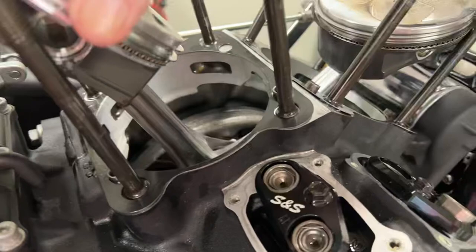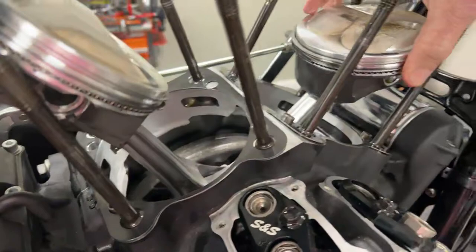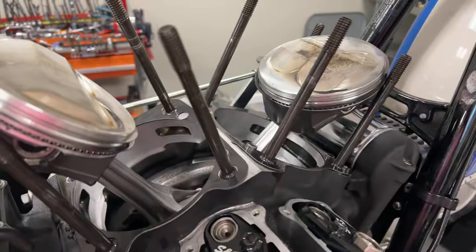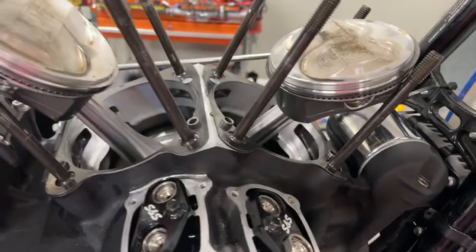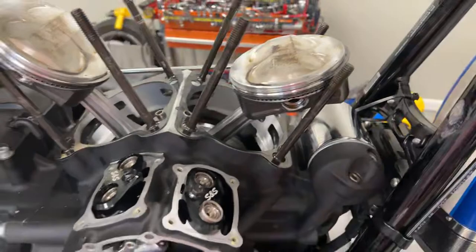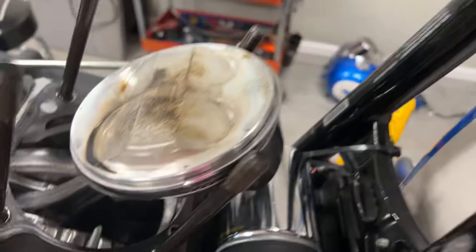On this motorcycle, it has a stock crankshaft and stock rods. It went to GRC — Stanley Gardner up in Maine — to get trued and welded. But we stayed with the stock crank and rods. A lot of people like to go all out on a crankshaft and that's fine — there's nothing wrong with that — but the stock crank has worked out well for us.